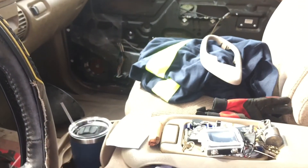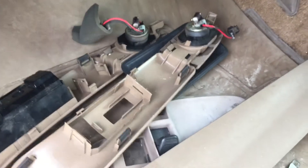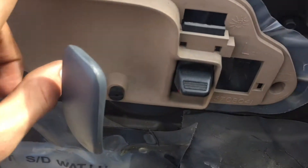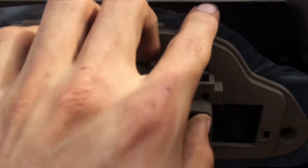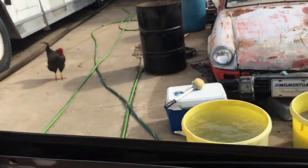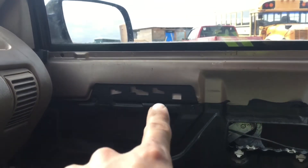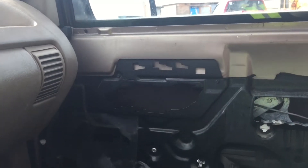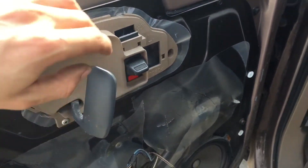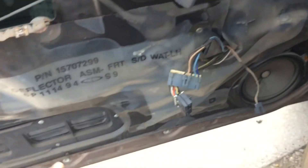I don't know about tweeters — comment below on those too. I'm gonna hook them back up just to make sure they work. To take these door handles off: take the rivet out, then on the back side there are three tabs — push them out and it comes out. To put it back in, push them in and slide them in, then the rivet or self-tapping screw locks it in. Real easy.